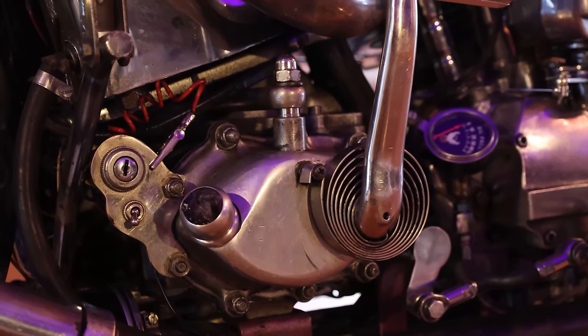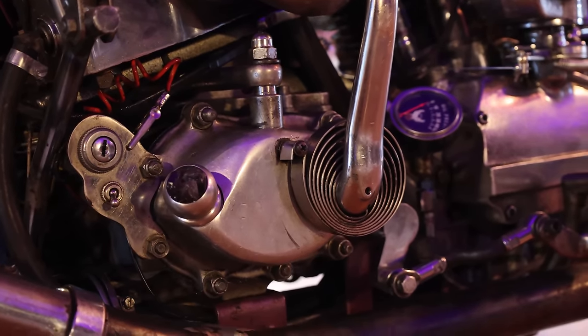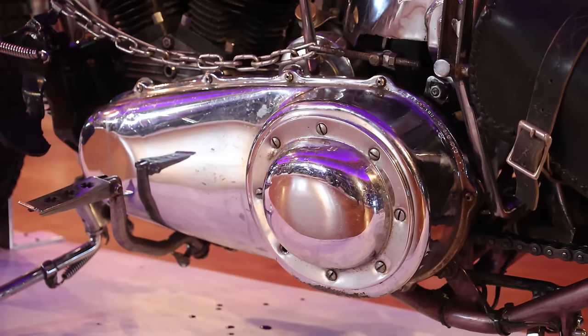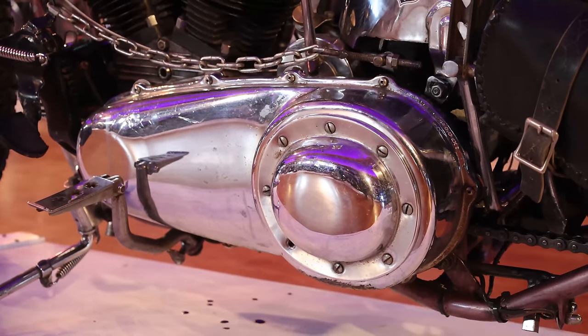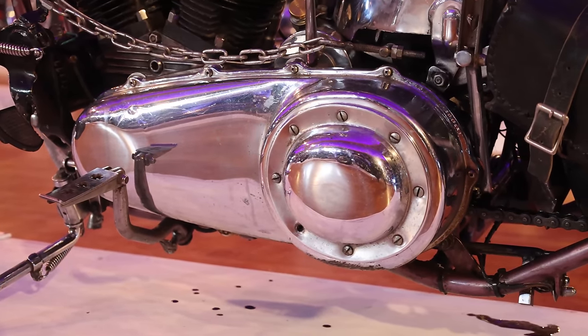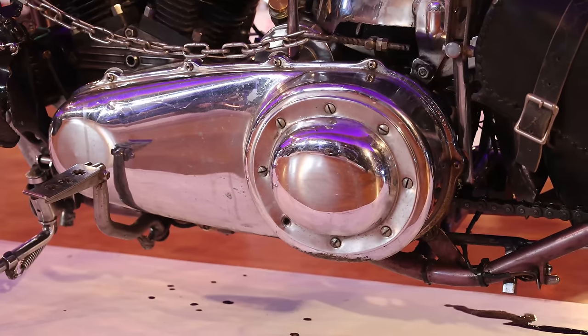Yeah, it's a ratchet top off a shovel head. If it's a ratchet top, you have to convert it to the knucklehead length main shaft. Really easy to do. You just basically buy the shaft, a couple of little pieces, and then you can put it together. You gotta make your own primary. Again, not that hard. You just screw around with different pieces until it fits right, and then you go, yeah, okay, weld it together. That's it. Fire it up and run it.